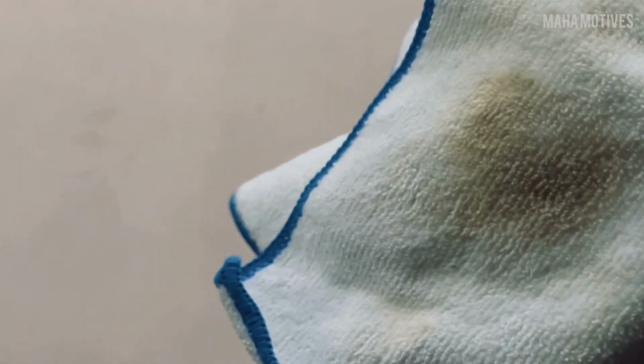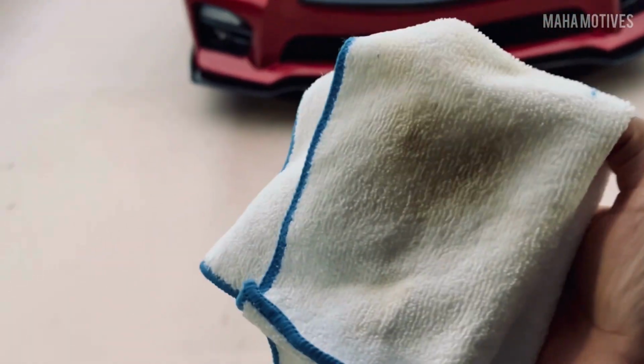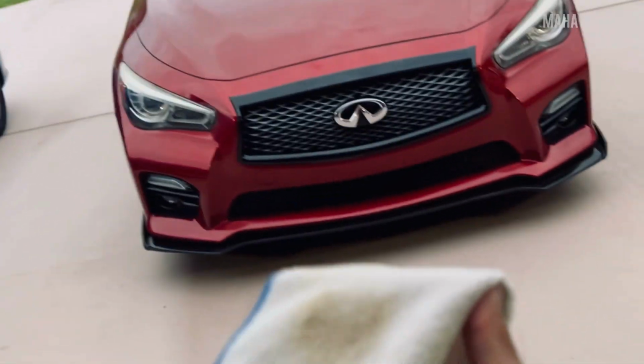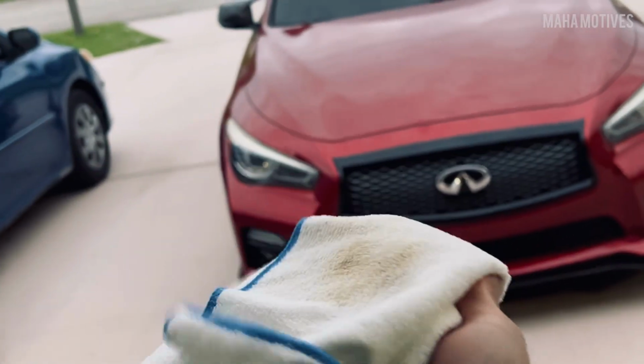This is why I always tell you to clean before you install anything. Look at all that, and that's just the top of the headlight. Now all that dirt is in between the 3M and the headlight, and over time, maybe instantly, if I first take it up to 80 miles per hour on the highway, it'll blow right off because the dirt got in between the tape and the headlight itself. So clean as much as possible, man, until it's clean.